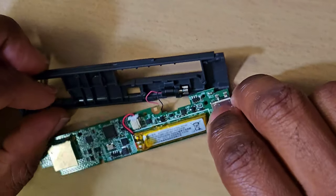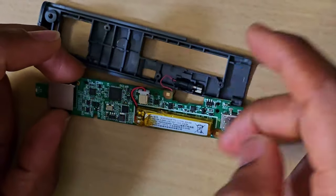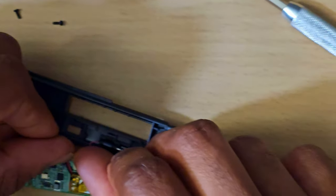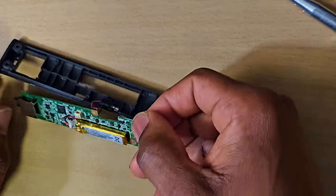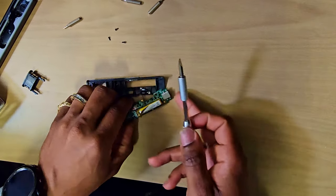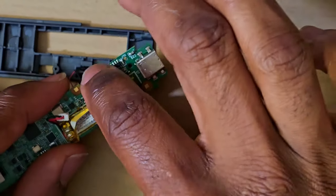Now that this is out, I'm going to flip it — and now the battery is exposed. I'm going to put one finger here and one over there, and use my two thumbs to pry the battery out. The battery seems to be held in by some type of adhesive, so I'll take a flathead and pry it up. There we go — that's out.